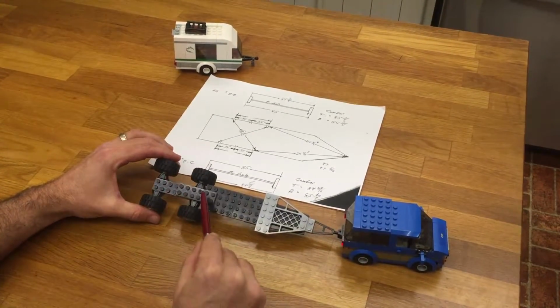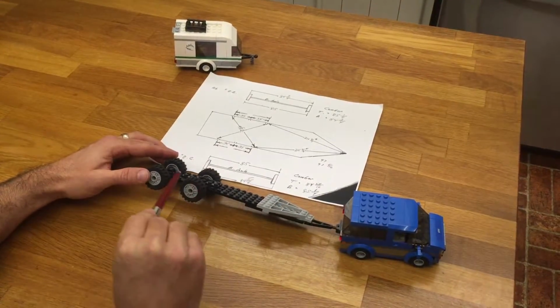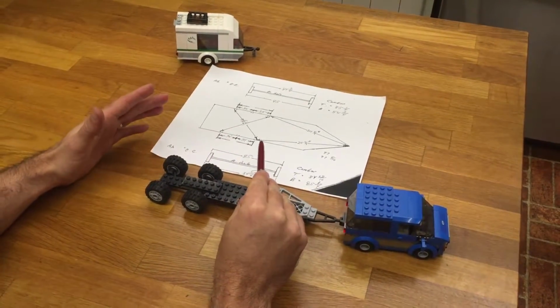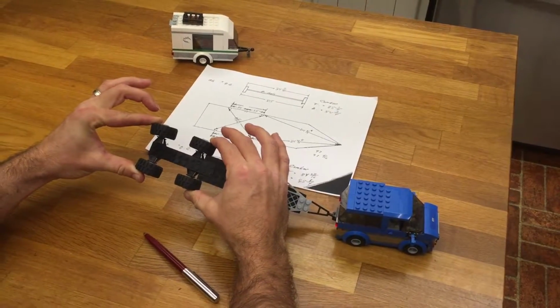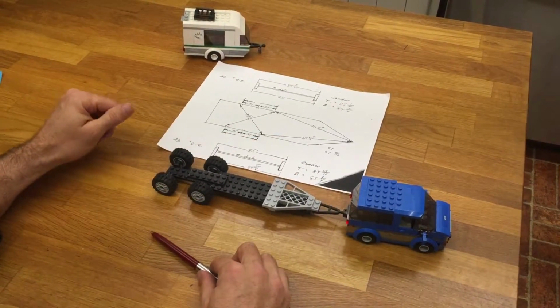Those weren't horribly off, and we also were good on our hangers, so they checked from hanger to center, center to back, and they did that on both sides. Those were both fine, so that means we also didn't have any frame damage there as well. But our major issue was that our axles were going down the road basically with bent axles. The front, not probably as bad as the back, but that's going to cause the excessive wear.